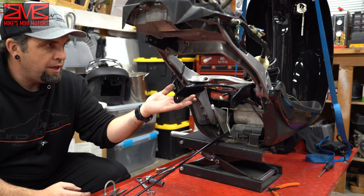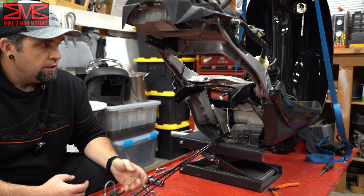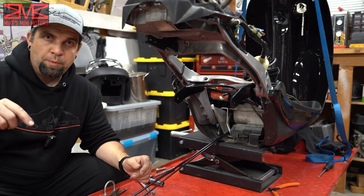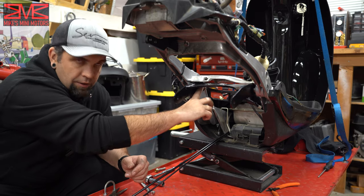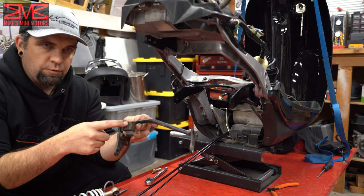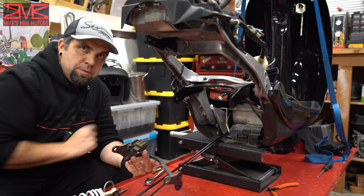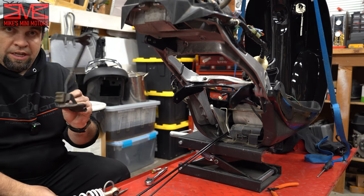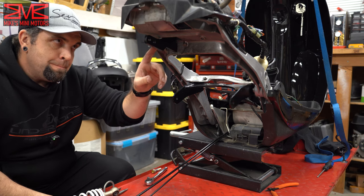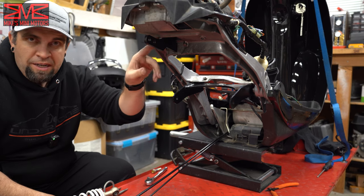There's the full stretch kit installed — got your main bracket, your shock mount, and the extended cables since that's what I purchased. Now we're ready to just slap the motor back on. Before I do that, I'll show you the stock hanger. This is the stock hanger off the engine — it's got the rubber bushing right here, and that went up in the same orientation captured in that same spot on the frame. We won't need that anymore. One thing I did want to point out is on the shock mount, just to get it to line up so I could bolt it in, I did need to trim it just a little bit, but not too much — just be aware you might need to do that.